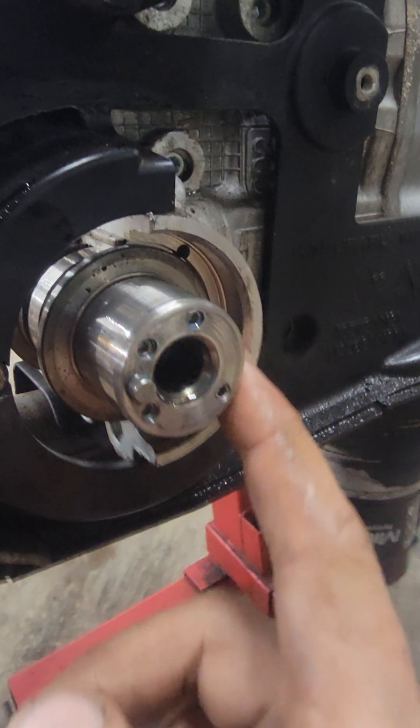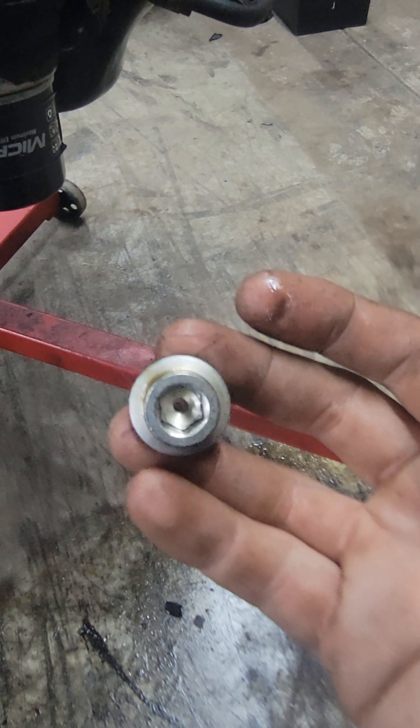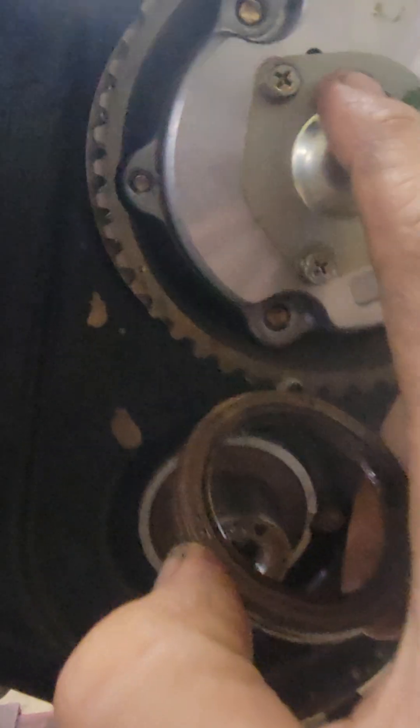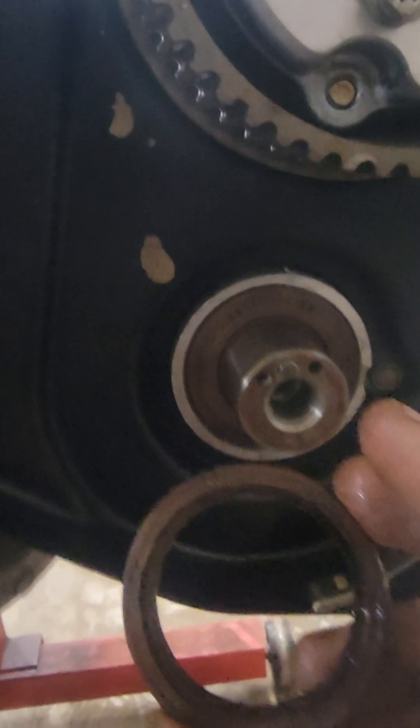Crank the cam all the way backwards with the gear and you should just be able to see the hole. All done. Put it back together, install a non-AVCS cam seal and a non-AVCS cam gear bolt — the AVCS gear bolts are hollow for oil return. Put your plastic gears on with a solid bolt. The cam seal has a little wire on the non-AVCS. Intake and exhaust are exactly the same, it just depends on AVCS or not. Get your cam seals right, put it back together, do the same thing on the other side, and you should be good to go.